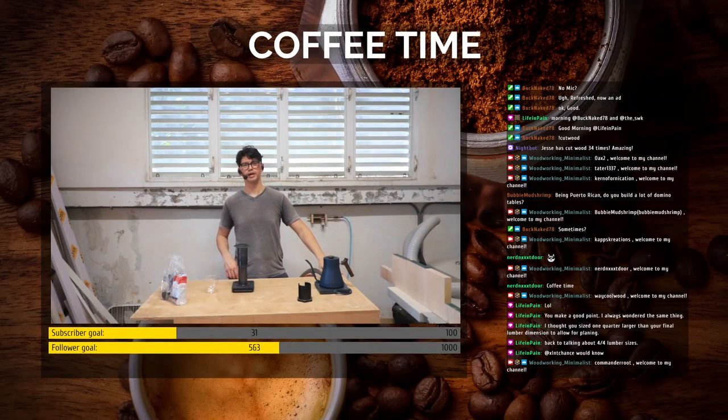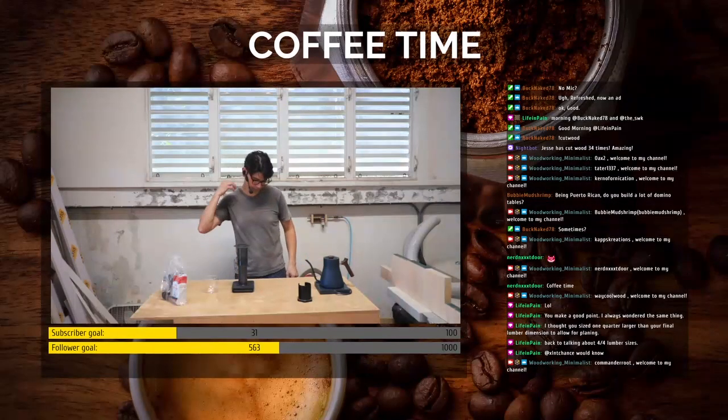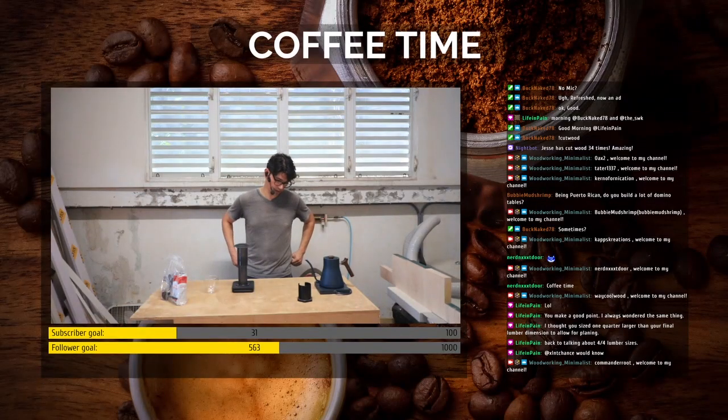I might have to descale my espresso machine again. It's making some hammering noise. And it could be either there's a valve that's not working correctly, or it could just be that there's some scale on the heating element and it makes cavitation bubbles. So it makes a better surface for the bubbles to form when it's really hot. So it makes loud, violent bursts of air inside the chamber, so it makes these weird hammering sounds. And I've descaled it not so long ago, but apparently I have to descale it again. Plus I'm using RO water, which shouldn't allow for that to happen.